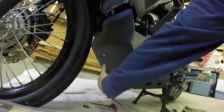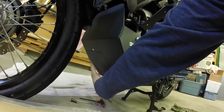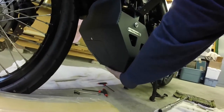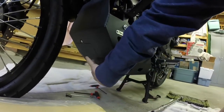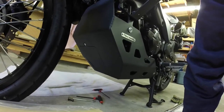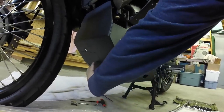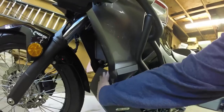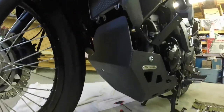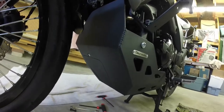The front is enormous — this is where the noise is actually coming from. I've got this oil port with a couple of Allen screws holding this massive port. I'm thinking that's what's resonating because it's only held on in two points separated by ten inches or more, which means this large piece of metal is only fastened in two places, hitting sound off the headers with a plate that's not part of the normal plate itself.